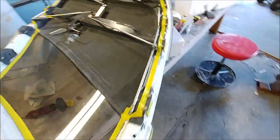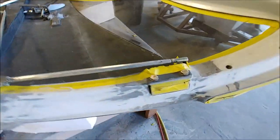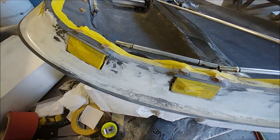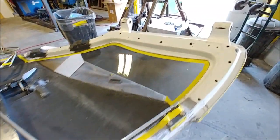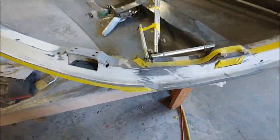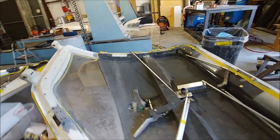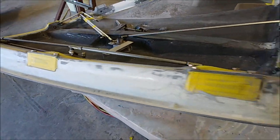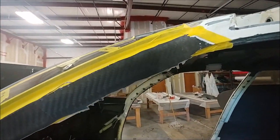Here you can see I've got the doors now masked up where we're actually going to be painting. I won't be painting the inside section because it's going to get a door trim over it — it's just a waste of time. Everything outside of the yellow masking is what's going to be painted. I'm not bothering to take the door locks out — just too much effort. The top frame there will get painted so it'll look all fresh. Later on Thursday, I've got it sanded mostly around the edges and ready for another round of primer.